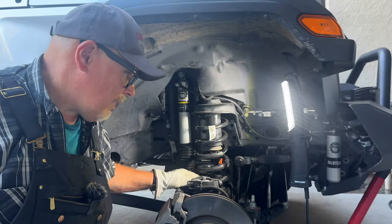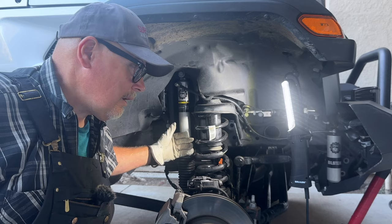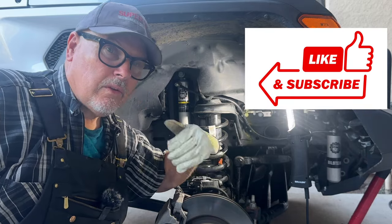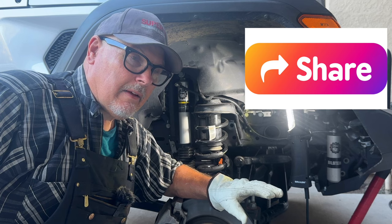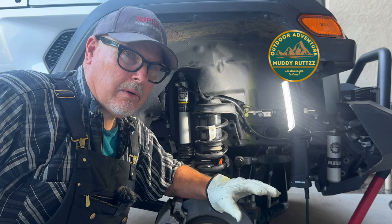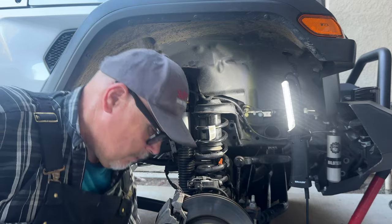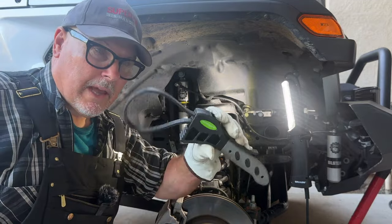At this point I need to install the bump stop extension in the front on the frame. I didn't get video of doing that, putting the shock on, or putting the sway bar end link on because I was running out of time. I'd been out here all day and ran into a heck of a problem putting that bump stop extension in. I didn't have the exact right tool. I tried a bunch of different ways and I think I spent about three hours putting just two bump stop extensions on — a job that should have been a five-minute job. What I ended up using was a vice grip with a socket on it and a strap wrench which I just happened to have in my toolbox.